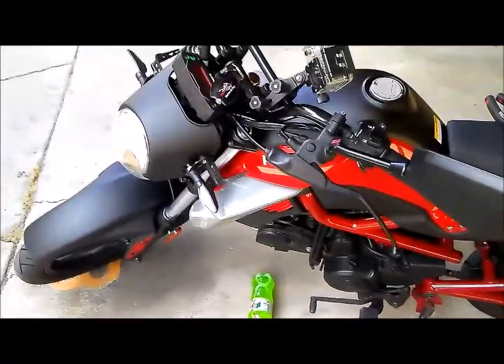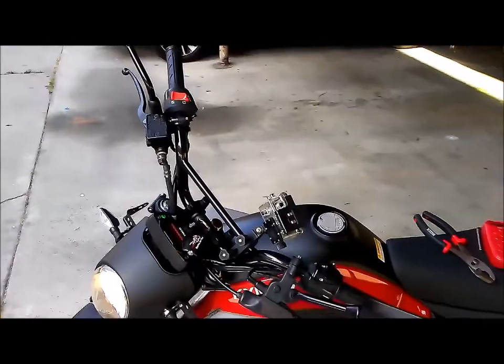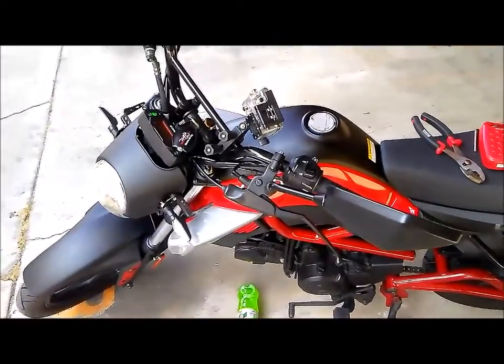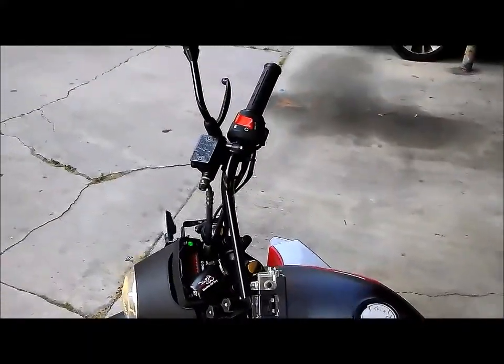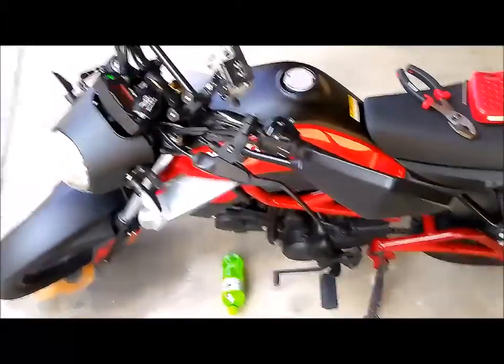So yeah, I finally got 1300 miles on this thing. Got the oil changed, new spark plug. It's only one, might as well just change it. It's so cheap, unless you're just too cheap to do that. They said you could clean it, but it's like, why? So I put a good spark plug in there, just another NGK, that's what came in it. It's definitely running a lot better now since I put the spark plug in and did the oil change. I'm using a synthetic four stroke oil on it, and you could definitely tell the difference after that oil change.